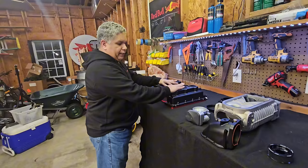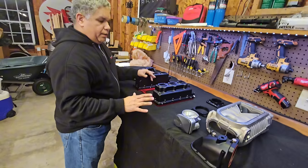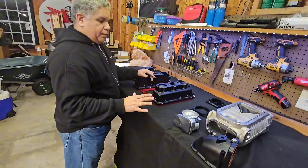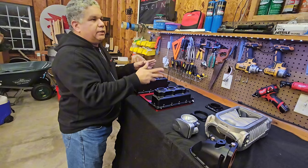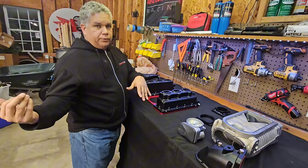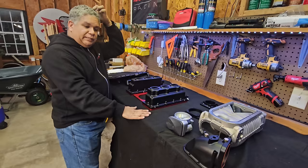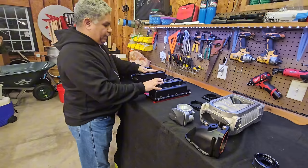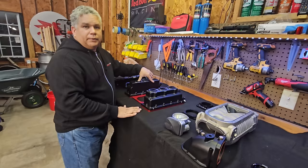The kit itself is very easy to install — it may look complicated right now, but it's not. The kit comes pre-assembled. The only things you have to do when you get it are: remove the cores and top cover, install the blower on top of your engine, connect the clips, set up your throttle body, put the top on, and go. We're filming a full DIY install video this weekend so people can look at that and know exactly what they're getting into and what to do when they get it themselves.